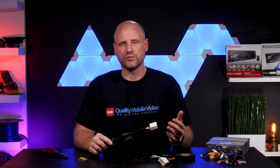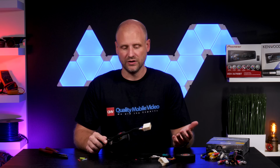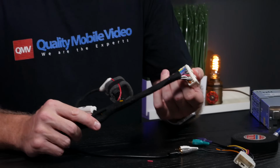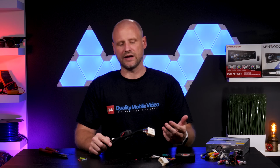One surprising question we get is, do I even need a harness? Well, technically you don't. The one thing you'll face though, is you'll need to actually test every single wire because there won't be wire colors that match those in the aftermarket. Whereas the aftermarket harness makes this really easy. And the aftermarket typically maintains the same color standard, both on the radio side and the interface side, making wiring much, much easier.